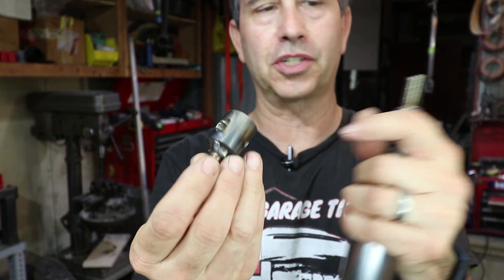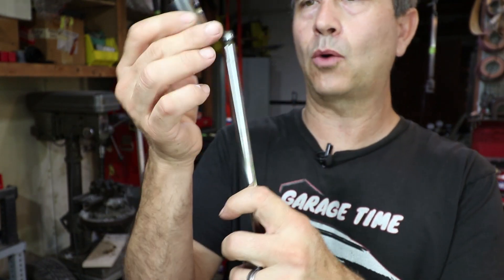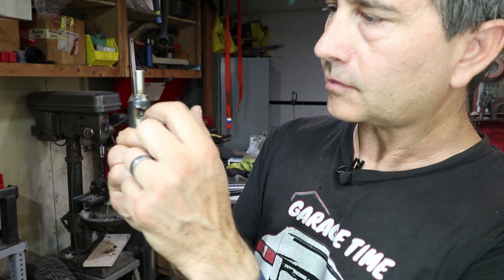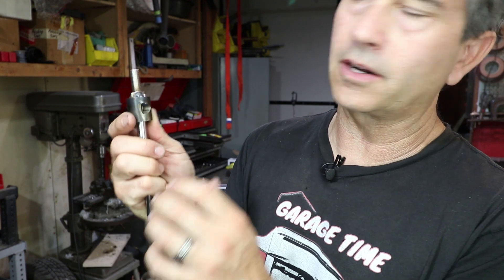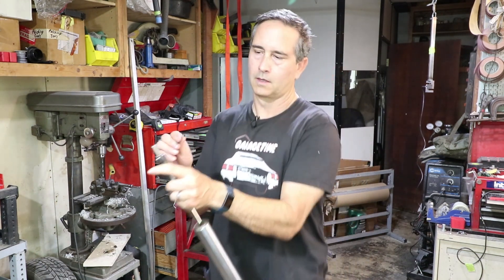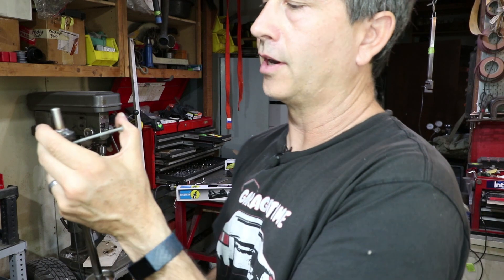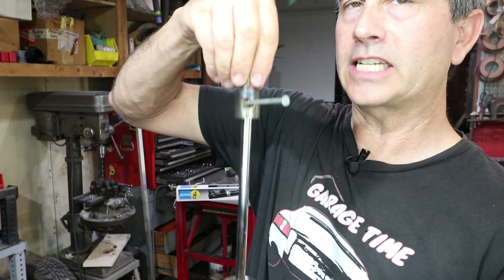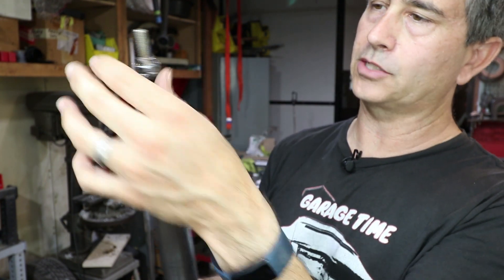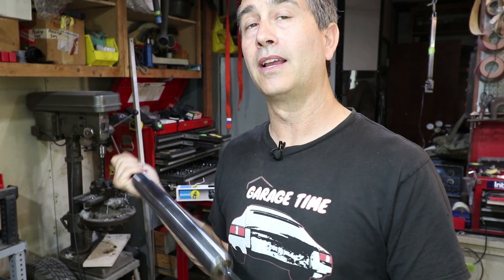This is what I've been busy making. This is just a piece that slides onto the end of the old cartridge. I didn't quite get this hole position in the right place, but it will lock onto this little circle cut out on the shaft. That goes through and then there's a pin that locks it in place. Instead of using the original roll pin — my hole's off a little bit — I have to use a smaller thing, just this nail at the moment. If I push this in hard enough, it will capture the end of this. So that captures it on here. I can attach my load cell onto that end. I also welded a bolt onto the end of two real thin nuts, so this will thread onto the upper part of the strut cartridge and onto the bottom. Now I can do some pushing and pulling and see what kind of force this thing generates based on the velocity.